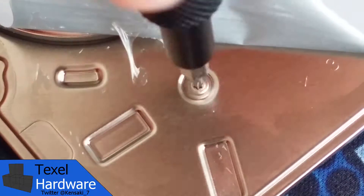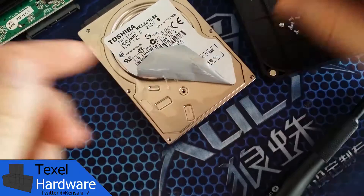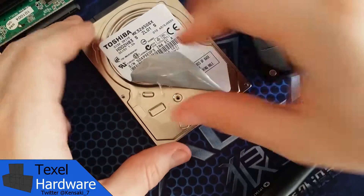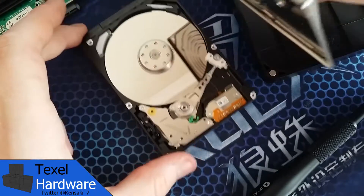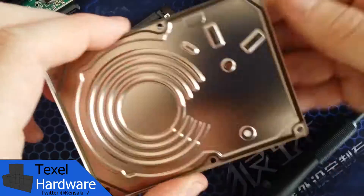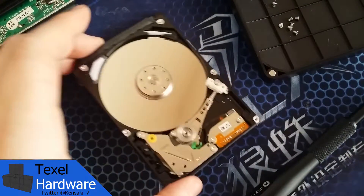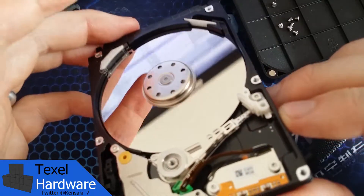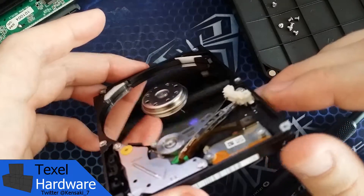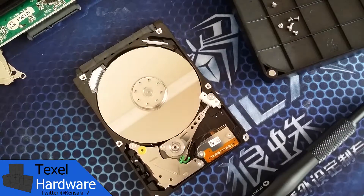All you've got to do is continue using your T5 tool that's still in your screwdriver, and once that's out just lift off the cover very gently and carefully. For the first time you can see the insides of your hard drive: the beautiful mirror finish on the platters, the hard drive magnets, and the motor assembly for the arm and actuator motor.